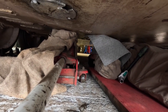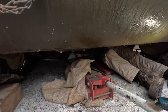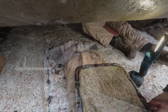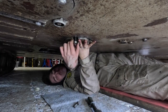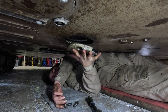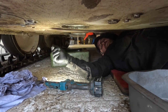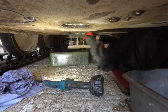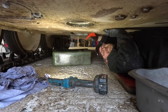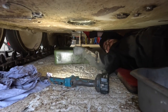Ollie is trying to remove this base plate so that we can get underneath the engine. Today we're changing the engine oil in the AMX 13. I'm going to undo what I believe is the sump plug — I haven't been under here for quite a while. It's hot, there's lots of it — it's diesel. Now all I've got to do is keep my eye on the fact that this container doesn't overflow.